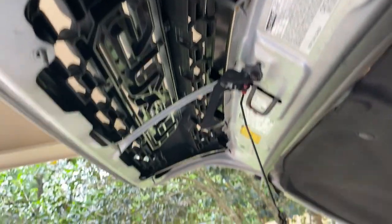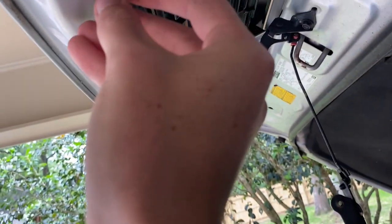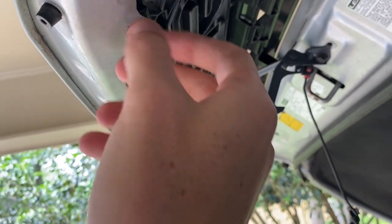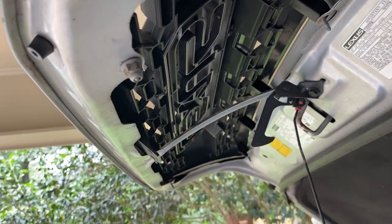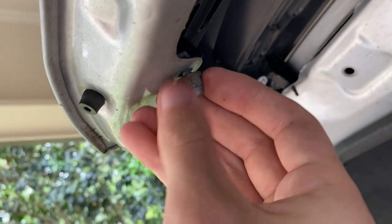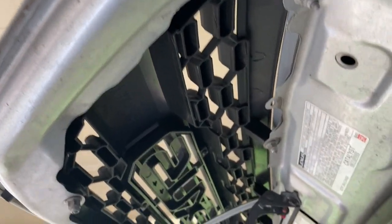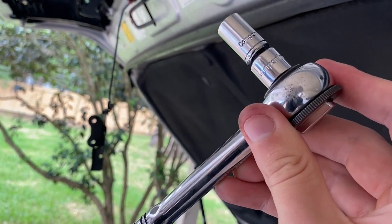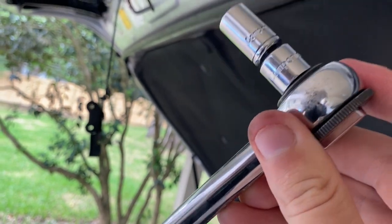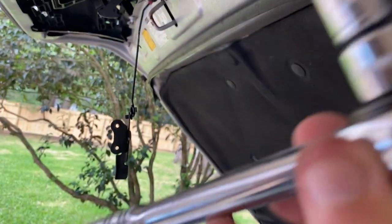Once you have the grille sitting in the hood on the screws, you can take the nuts you used when you took the grille off and hand tighten them on to the pegs. You don't want to tighten them down just yet — more of a loose tighten — so you can get the grille in place before you tighten it down. Once all the bolts are hand tightened, you can then take your 10mm socket wrench and begin to tighten them down. I'd suggest not over-tightening because it might cause the rectangular screw to spin, making it really hard to tighten further. Just make sure they're snug, then move to the next one.